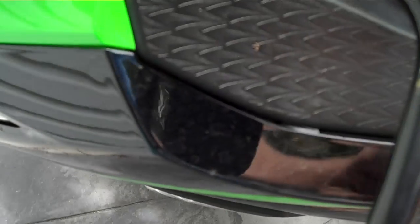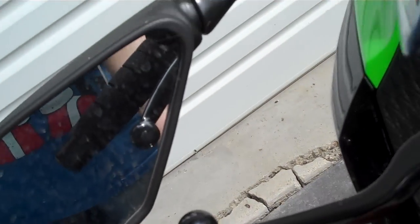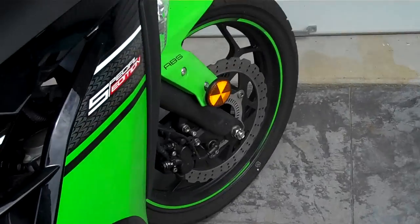The other thing I suspect they might try is — I don't know if you can see it on my camera, but I can. Getting the right angle, I can actually see straight through this crack. There's a crack in here — there it is, just in front of my finger, that little square hole. You can actually see straight through this fairing all the way down to the ground. I suspect they might even shove some double-sided tape or really super sticky tape up on the inside.